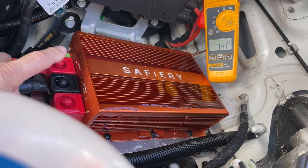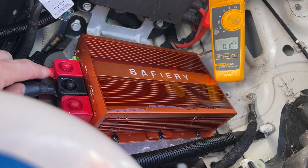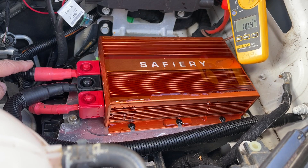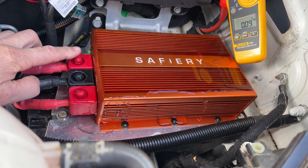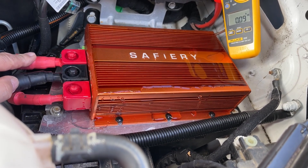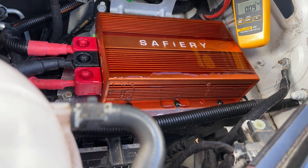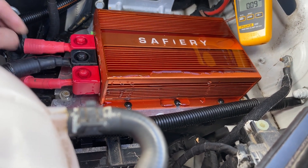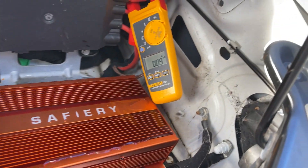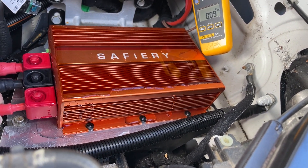The tricky part for people is when it doesn't perform — it's the size of the cabling from here. If the cable is too small, you'll get red and green light flashing, because it just can't hold the voltage. Now, this is only 80 amps, and with Scotty we pulled 250 amps out. So in this case here, we've got a 50 millimeter cable coming out from here up into the fuse block up there — you can see where I've got the clamp meter on — and then going out to the battery in the rear.